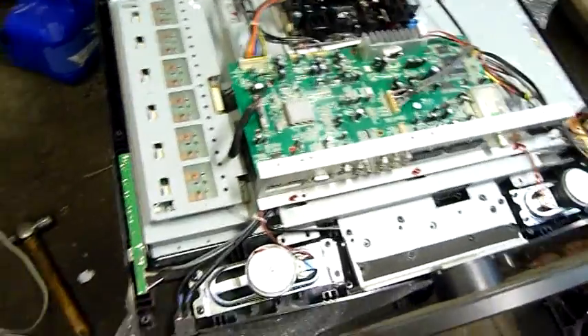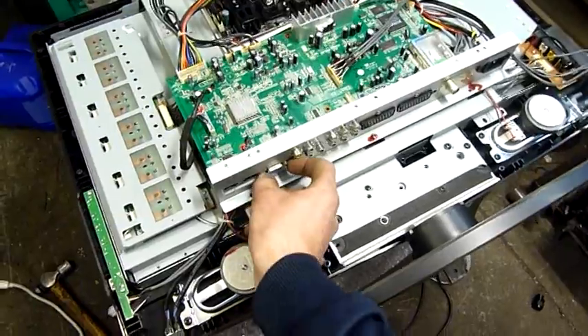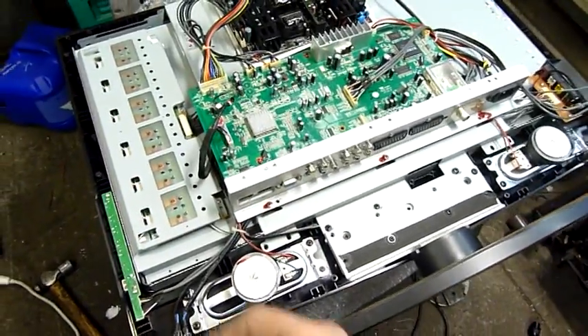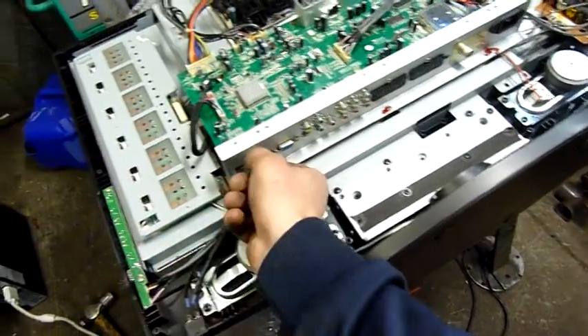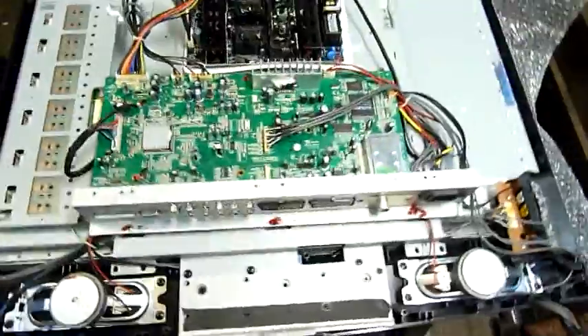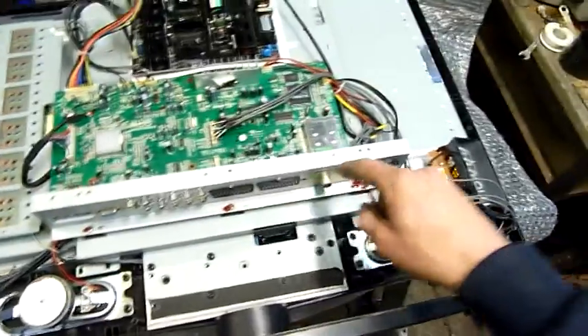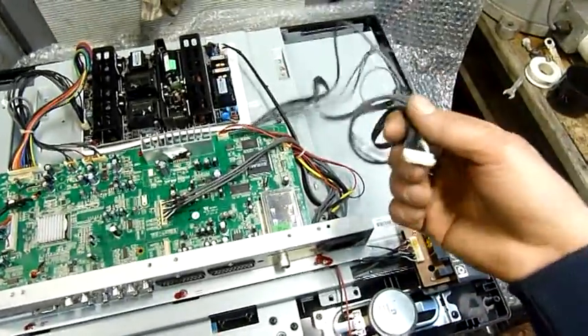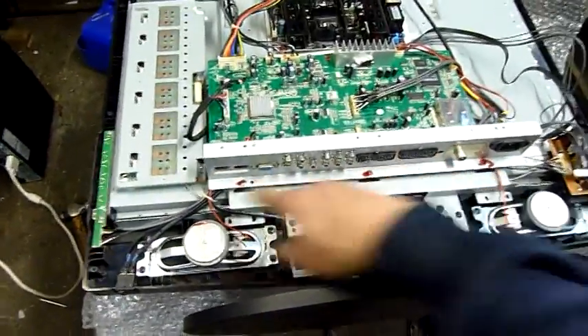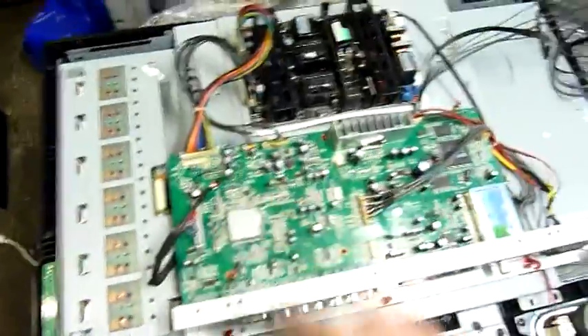I can screw a steel bracket to the wall and that's it — a bare bones 26-inch monitor. I'd prefer just D-sub and DVI input. I don't even have an appliance around here that uses HDMI — my old plasma TV in the house is standard definition. I know there's no component, D-sub, tuner, and inbuilt DVD all display the same problem with the red ghosting, so it doesn't matter what input I'm using — barring SCART and HDMI which I can't test — it's all doing the same thing.